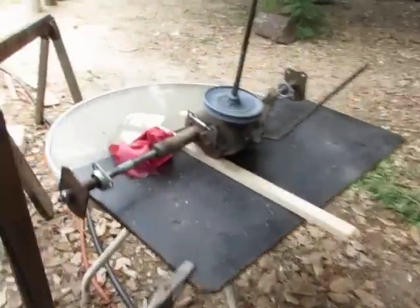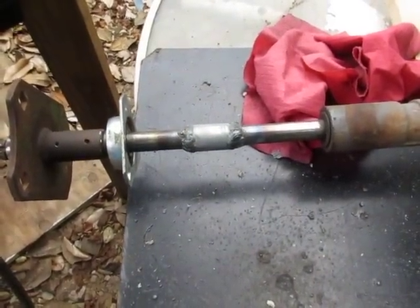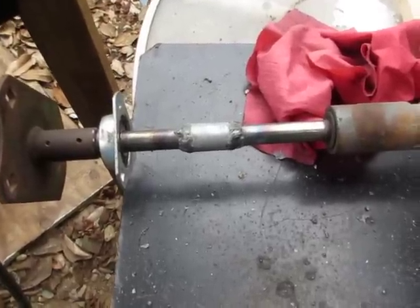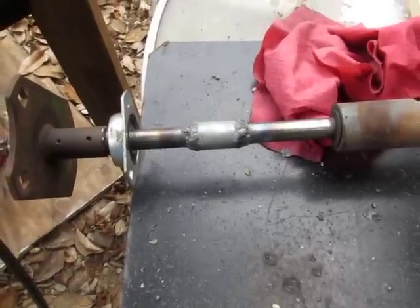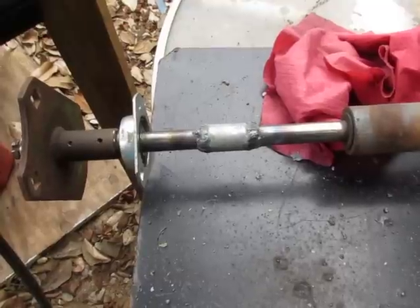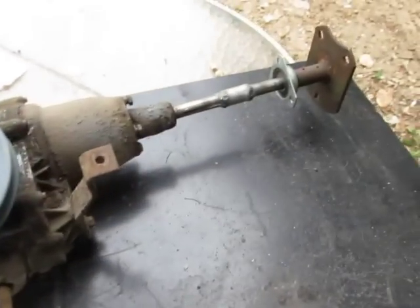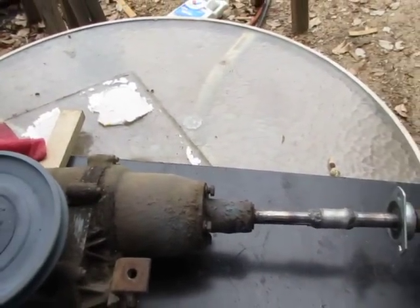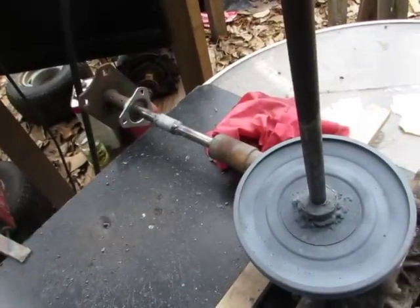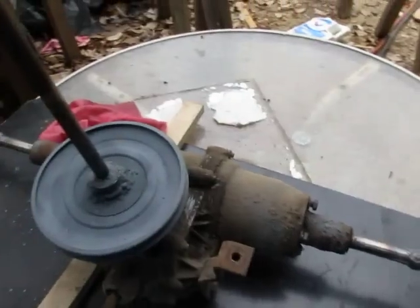I'm about ready to install the rear end. I've finished welding these today, simply using an old method of using angle iron and clamping the axle together to keep it lined up. Welded it completely around because I had to grind a deep V in there and filled it in with weld, then ground it down so that the collar would slide over both halves, and then welded the collar. As far as I can tell, they're both straight. It's hard to tell when you're spinning it because the transmission wants to move. That side over there is definitely straight. This side, I'm not so sure — but it wiggles around.